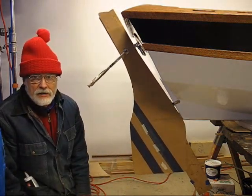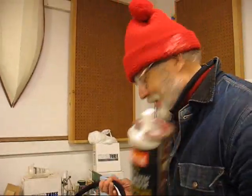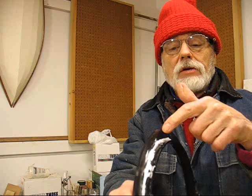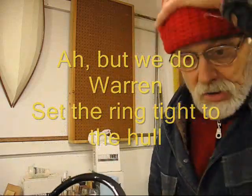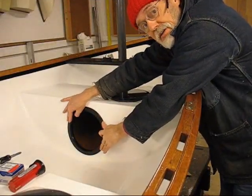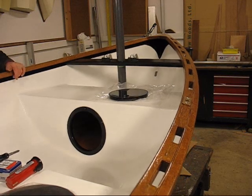We'll go on to the hatches inside. I like to use a nice silicone sealant around the edge — I just wish I had a newer tube. I had to cut the end way off and squeeze hard to get a bead out. You want to put a bead inside the flange, then stick it in the boat and put in some screws — but don't push it all the way in. Let the sealant fill the gap and harden up. Press it in tight and give it a little wiggle left and right to get it to seat.